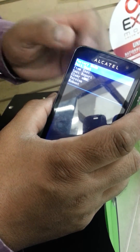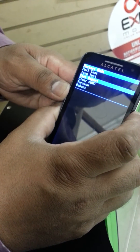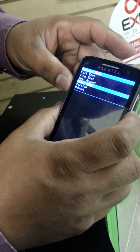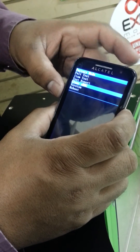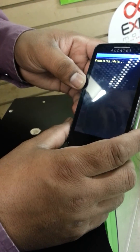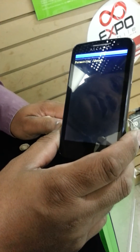Go down to find and select 'clear the MMC'. To select it, press the home button. Then wait for the phone to reset.